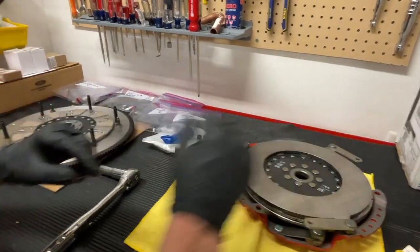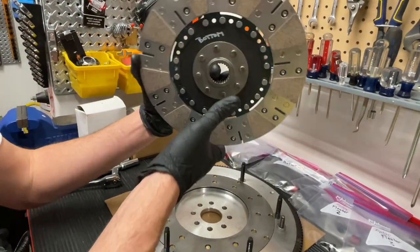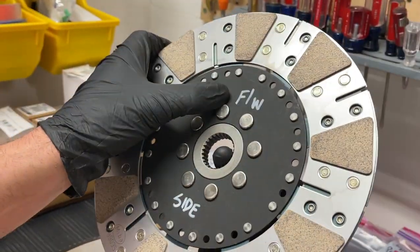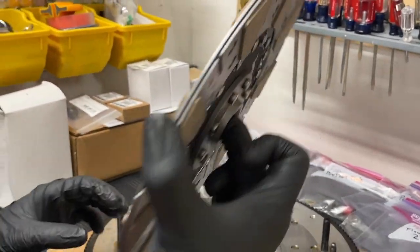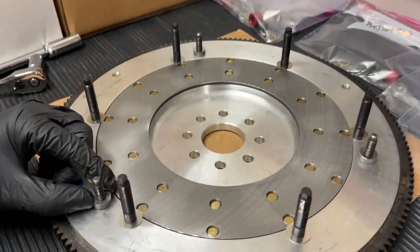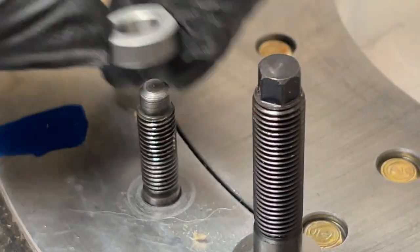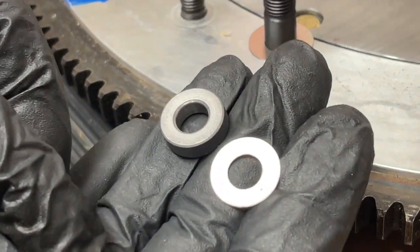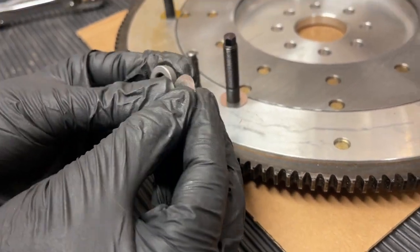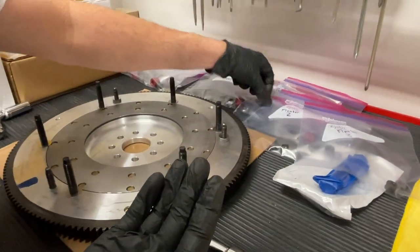Next we take off the second disc, which is the bottom disc. Don't think that means the bottom of the disc — the flywheel side still faces the flywheel. Now notice where the floater straps were: once removed, there are shims as well as a spacer, called a stand. There were actually two small shims and a spacer — the factory may have it set up differently depending on the specific unit, but this is what it looks like. We're keeping that in our floater bag, everything kept separate.